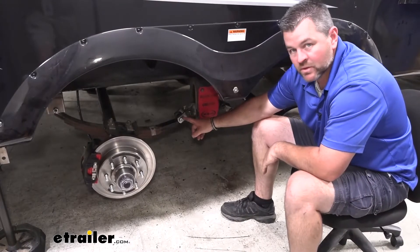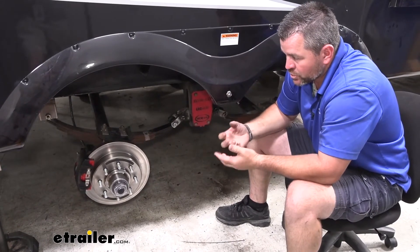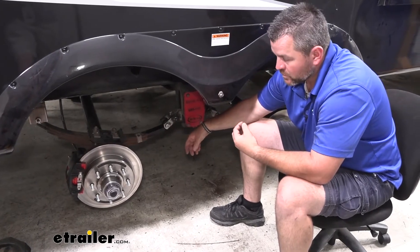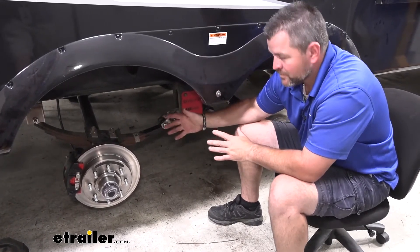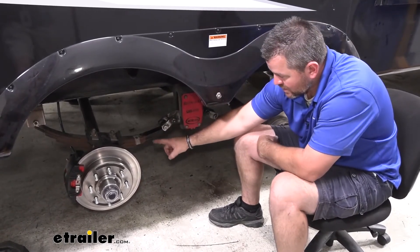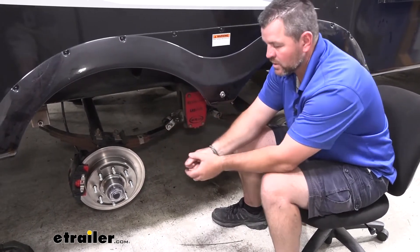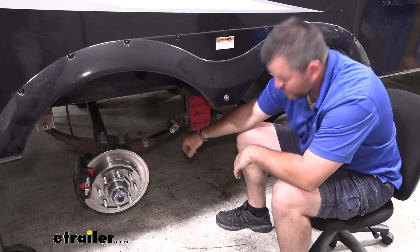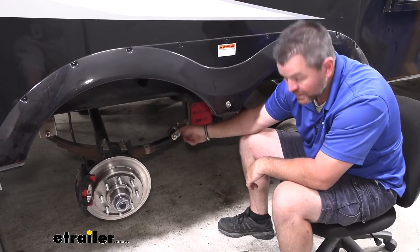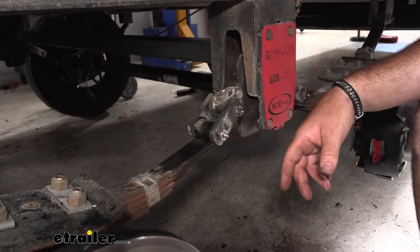As far as knowing if you need to replace the bushings, there's really no way to tell for sure unless you're doing some other type of work and have to pull these bolts off. I suggest checking them every three to four years. One way to check is to put a jack under your axle and see if you can move the spring end on that bolt — if you can, that bushing is potentially damaged. Pull the bolt out and check it. If it's damaged, replace them all.